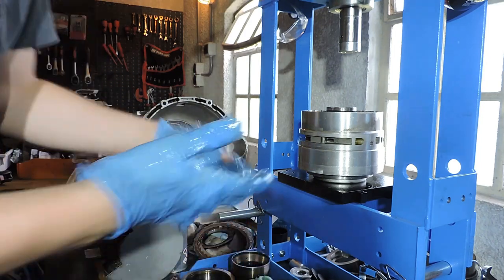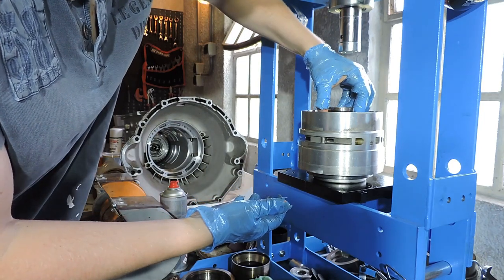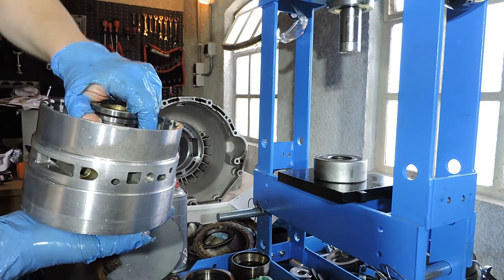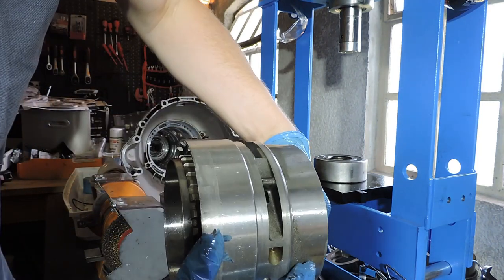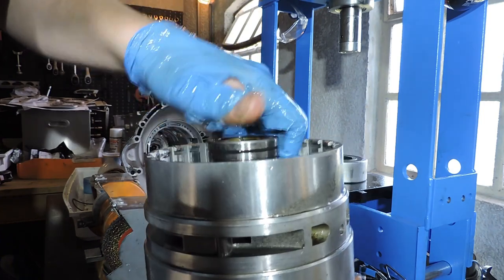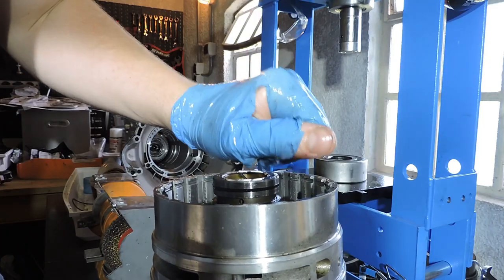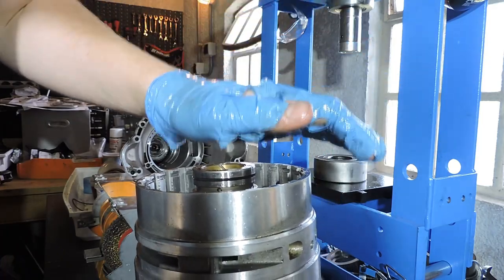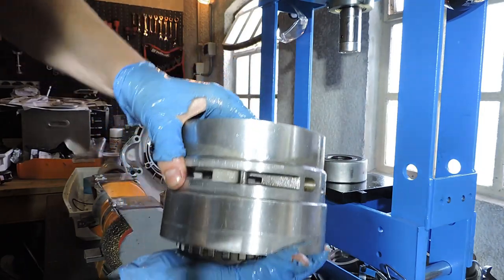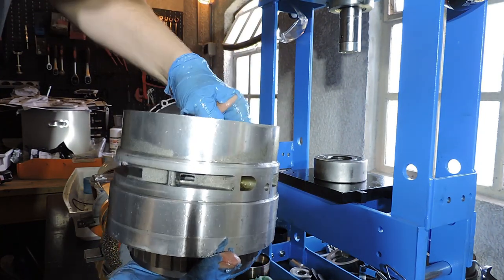It may happen that the moment that I lift it up, the shaft will drop out. So I'm going to put one hand on the shaft and support the drum with my other hand. And now this is the narrow side of the drum. This is the thicker side of the drum. To remove the shaft, it should be enough to use the palm of your hand, else just use a rubber hammer. And as I tap it, it should pop out. Let's see. That's it. And now with that shaft out, you can see on the bottom, everything starts to move. So you push it out.